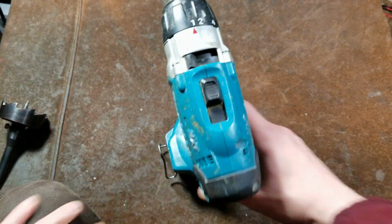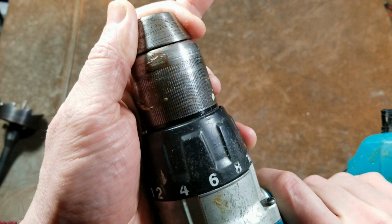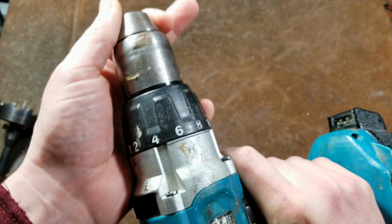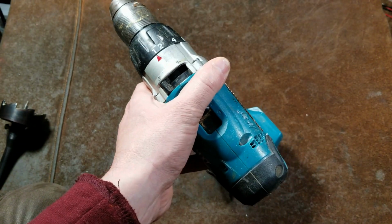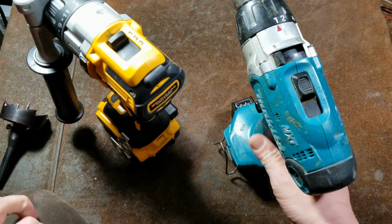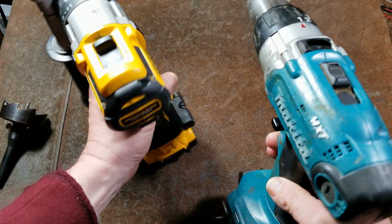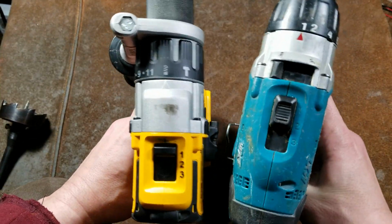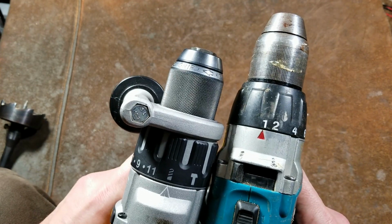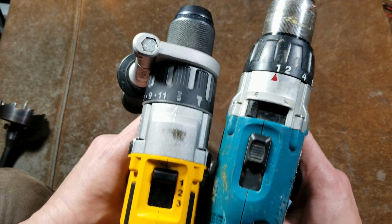They're huge, heavy. They use dual ball bearing spindles, so the spindle in this drill is just absolutely tight, just the same as a Milwaukee quarter drill or something, just as tight as it was from the day it came out of the box. But even with a drill like this, which will have a motor that can easily peak hundreds of watts of power, it's really surprising. They aren't as powerful as the more modern ones, and we can see how huge this is versus this DCD 996. Just quite a bit of shortening on the tool.